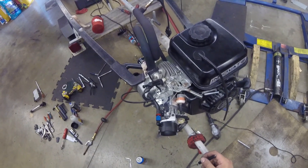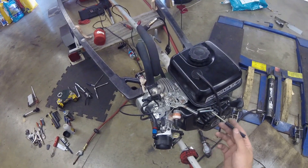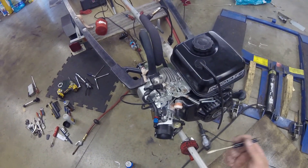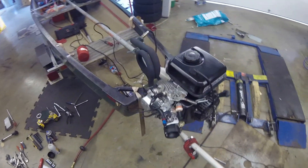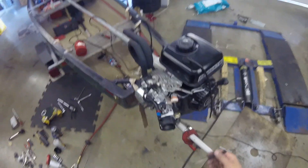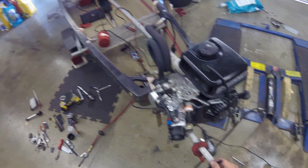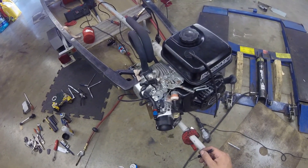I'm still gravity-fed from the tank, but I'm having a surging issue. I think I'm going through fuel so fast that the bowl level drops quickly. Around 5,500 RPM I get a surge where the engine RPMs go wham wham wham, and I can't maintain a consistent air-fuel ratio or good power.